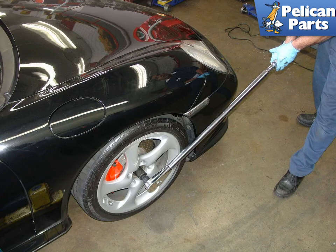If you divide 340 by your weight — for example 200 pounds — you will need to stand on your breaker bar with your full weight 1.7 feet (1 foot 8 inches) away from the center of the wheel. Do this with the breaker bar perfectly parallel to the floor.